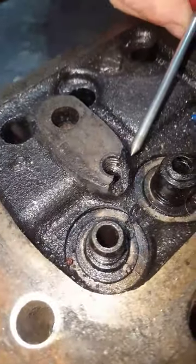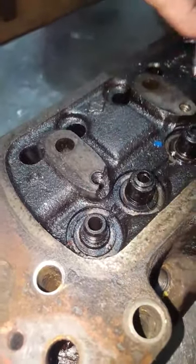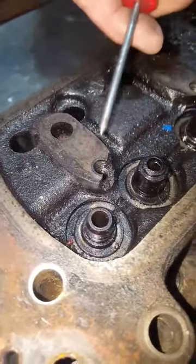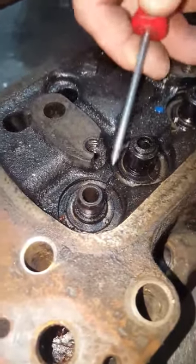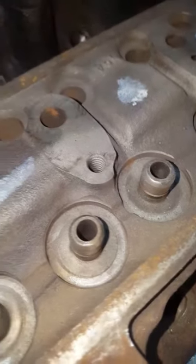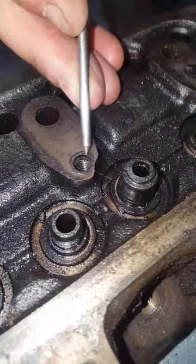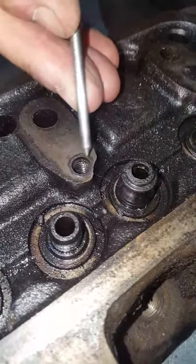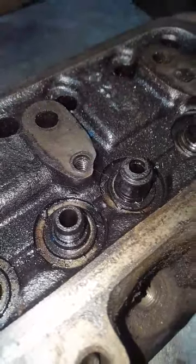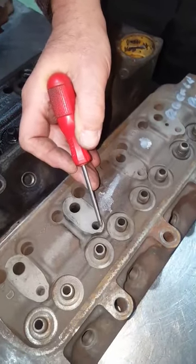It's completely scrap. What's happened is somebody put the stud in and kept locking it in further and further, most probably with a pair of mole grips, until it's literally torn the side of the casting away. They are sometimes thin — as you'll see some are a lot thinner than others. This one is very thin, close to the edge, and this one here has next to nothing left. If you wind a screw in with mole grips you can imagine it will just open up.